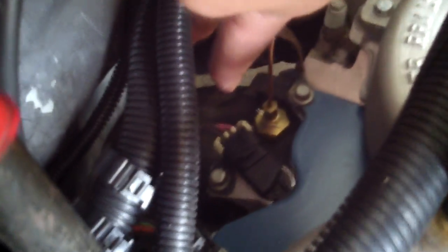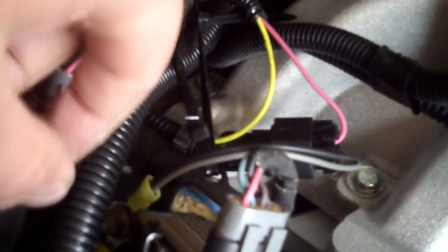There's your MAP sensor — this is for your vacuum advance and it gets programmed into the box. So you get two coil harnesses, clearly marked, and the MAP sensor which plugs right into the side of the manifold. Down below there's your cam sensor — factory cam sensor, three wires, clearly marked with the appropriate connector. There's another harness that comes off the back here covered in a high temperature special sleeve — that's for the crank sensor, also a three-wire harness, clearly marked. The crank sensor on LS motors is way down near the starter, because it needs to get the reference signal off the reluctor ring off the crankshaft. Super simple.